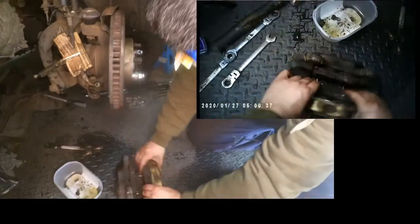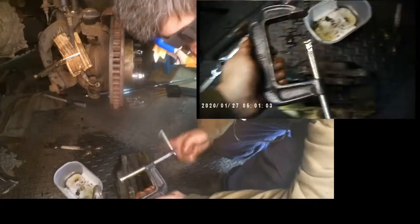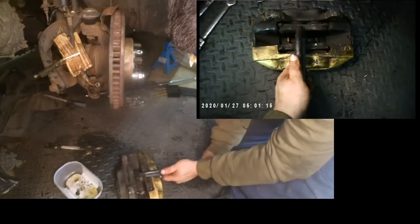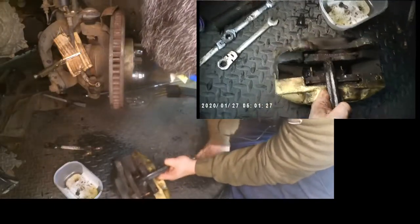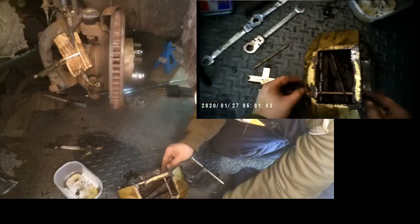What you need to do is use the old brake pad and get yourself a big c-clamp — this is a four-inch c-clamp, it's done a lot of work for me over the years. Slide the c-clamp in place; you may need to remove one caliper to slide it in place. All you need to do is slide the c-clamp in and start pushing the pistons back — that pushes both brake pistons in. At that point you flip the caliper out and remove the sliders.